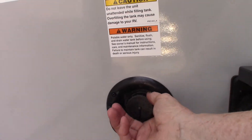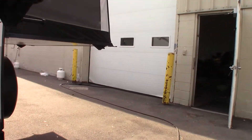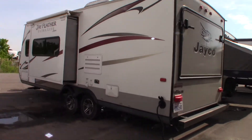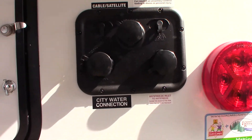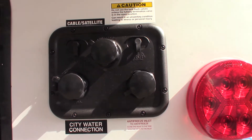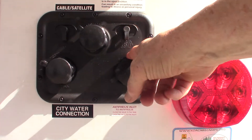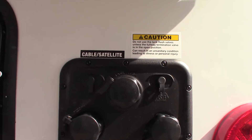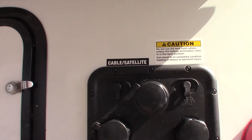This is the fill for the fresh water tank. If you go to a campsite that does not have plumbing, you can pre-fill the water tank using that fresh water fill. Nine times out of ten you're going to be using city water, which is right here — as long as the campground has city water, you just hook the hose up and you're ready to go. If you don't have that, you can pre-fill the tank and use the onboard water pump. This is an antifreeze inlet for winterizing the trailer. This is the black tank flush — after you dump your black tank, you can leave the valve open and put a hose on here and it'll spray off the inside of the tank. This is cable and satellite through.